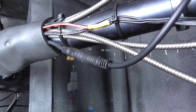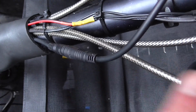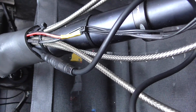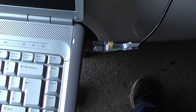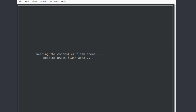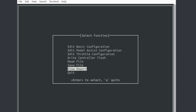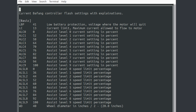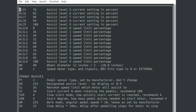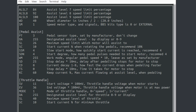I'm going to break out the laptop, connect it via USB lead, and reprogram it. To reprogram it you pull apart the lead that goes to the display — the other end goes to the controller, so you're actually reprogramming the motor end, not the display end. I use Linux basically because it's not Windows. I generally use the BDAT software — you connect it to the serial port, click read, and it reads the flash memory stored in the controller. You then have a number of options including reading reports and changing all the settings. The ones I normally change are the basic current limit, the wheel diameter, and for the UK setting, the maximum speed. Once you've set them how you like, you just upload them back to the controller.